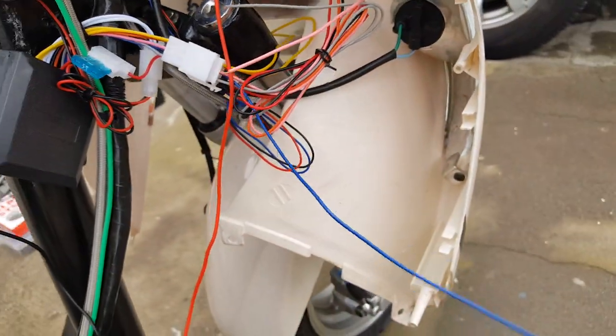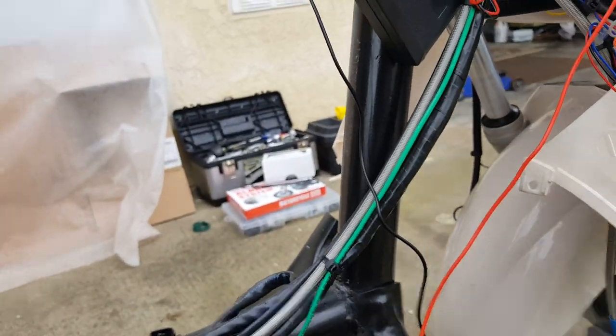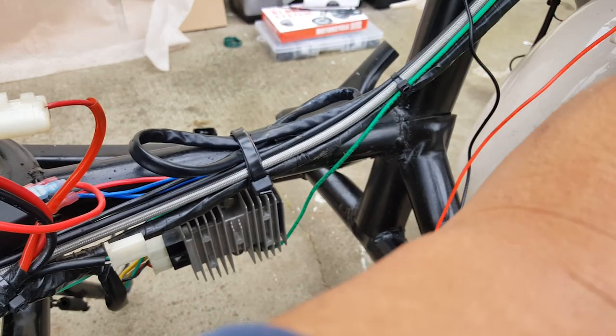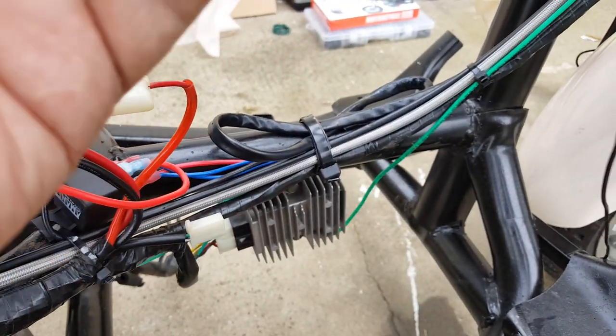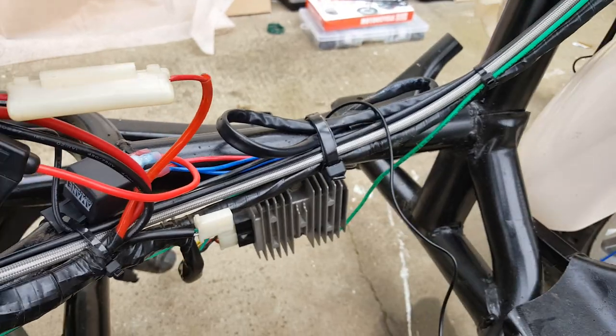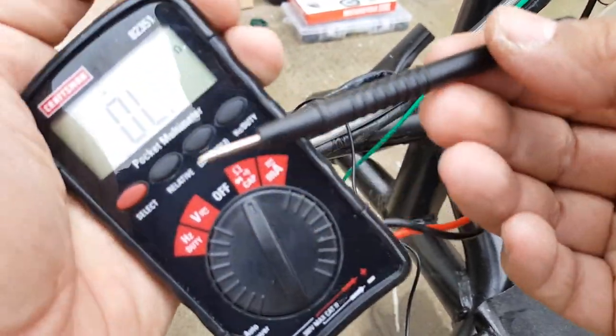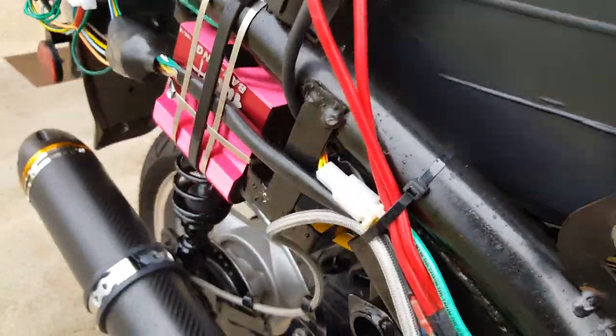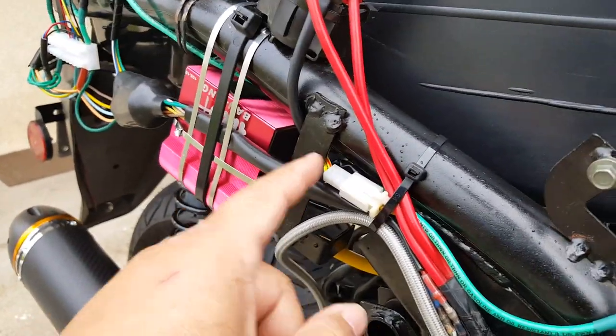So what we're going to do is take our blue wire — this is our blue wire here. Actually, we're not using the blue wire. Just testing continuity on the wire first. So what we're going to do is probe the other one here. Let me leave the blue wire alone. So I got my black probe here. We're going from the other end now, the wire that we think. So we're going to see that green wire is the same as the green solenoid wire that we were trying to test the blue wire on.